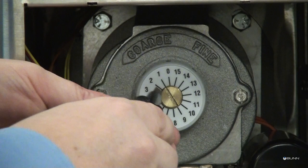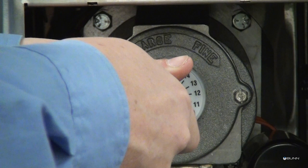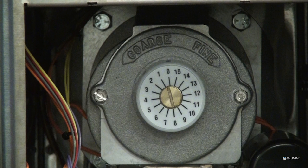After all the coffee in the grinding chamber is used, slowly turn the adjustment screw in a clockwise direction until a metallic whine is heard due to the rubbing of the grinding burrs. It may be necessary to start more than one grind cycle to obtain this sound.